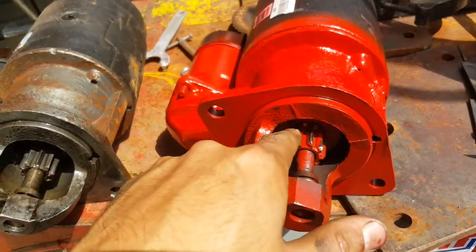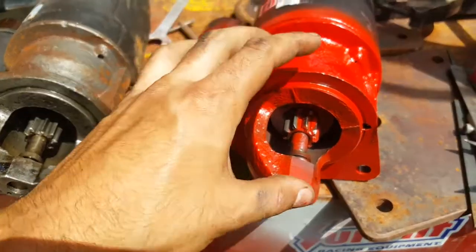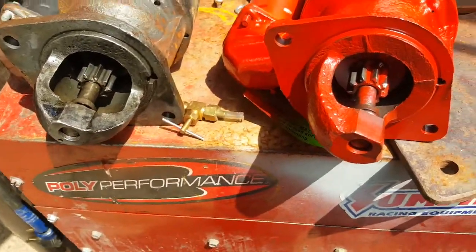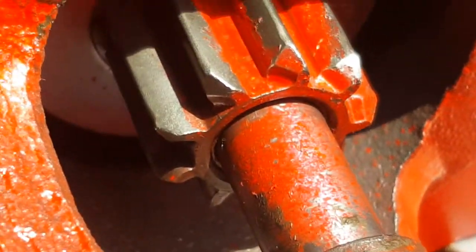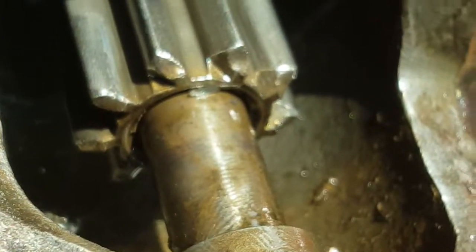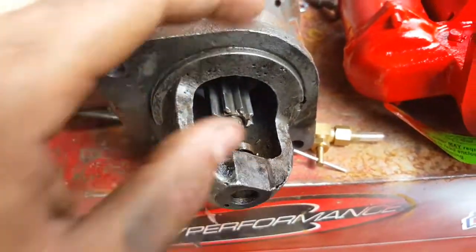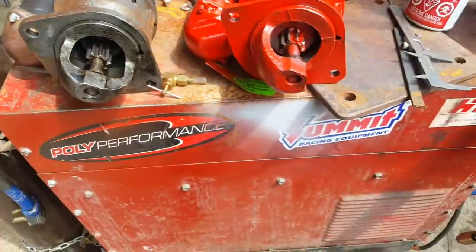This gear actually experiences a lot more force because it's so small. Remember, this little gear is turning the massive flywheel gear in the engine. These notches here, by the way, are normal. They're made there to make the gears mesh more easily. And as you can see, there are no bad marks, no deformation on the starter, so it's worked pretty well, except in terms of meshing, except for the fact that now it turns very slowly.